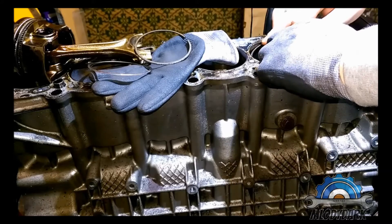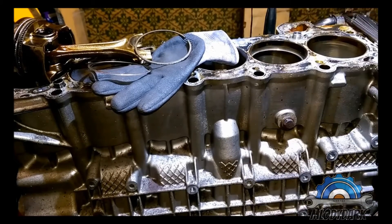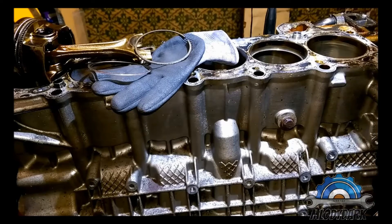If that car was burning oil, it was burning only a little amount. That's still off-spec, however oil scrapers usually have bigger gaps, and also when the engine is warming up and fully hot they expand, so the gap becomes smaller.